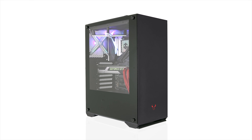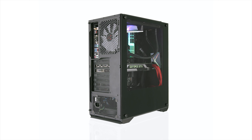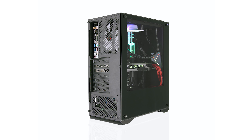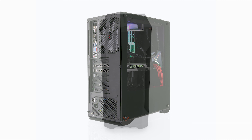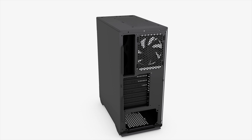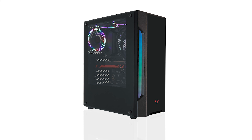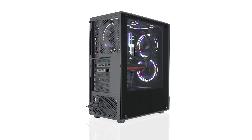The next case is the CR120BE which, while it can accommodate a full ATX motherboard, it has a short form factor, especially towards the front of the case. This makes the CR120BE great to use in spaces where a large full tower case will not fit. Surprisingly enough, this little case can accommodate a 240mm radiator at the top and offers a good amount of space for both the graphics cards and the CPU cooler.